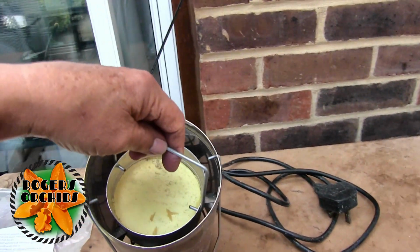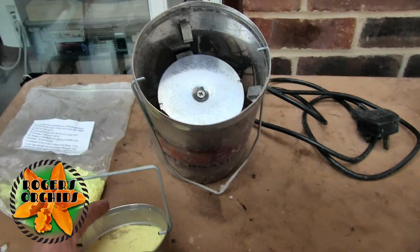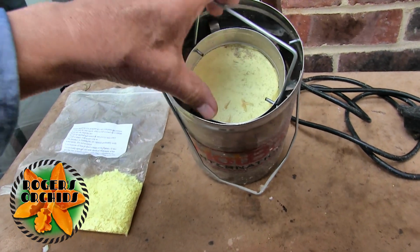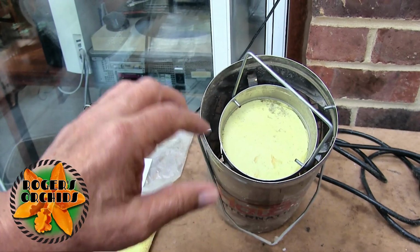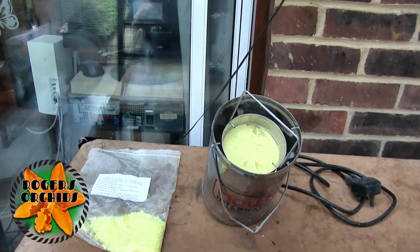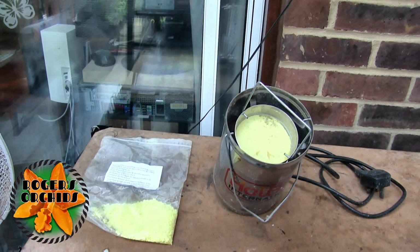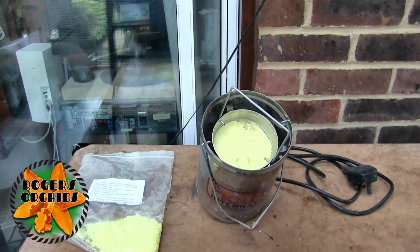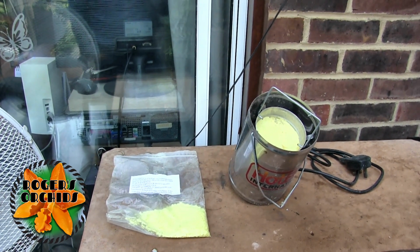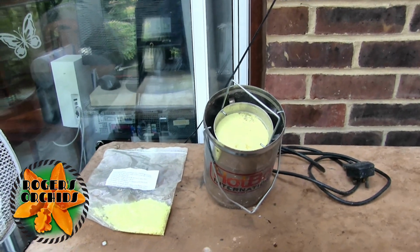It says if the plate gets damaged, then it's not going to function properly, because this has to sit absolutely flat on that plate. If it doesn't make that complete contact, then it won't get up to the right temperature. It's all these little things, plus the air clearance above it and the ability to take in air underneath and draw it up through the unit. All that sort of thing has to be done properly. And we will give it a go next week, because the fact that it's a bit grubby doesn't stop it working, does it? So we'll give it a go.